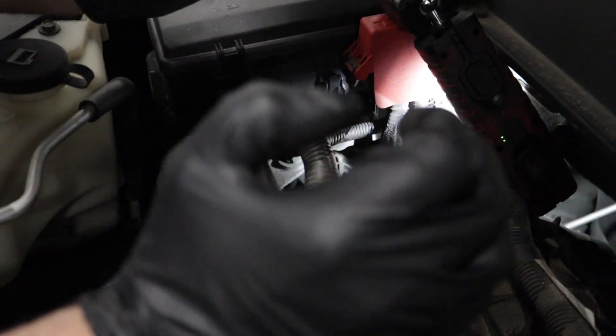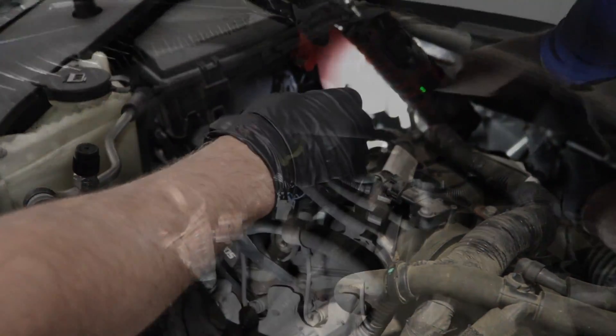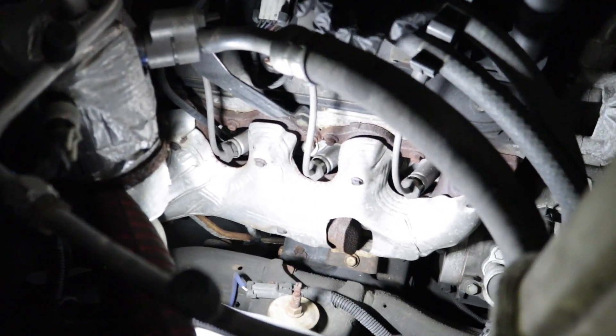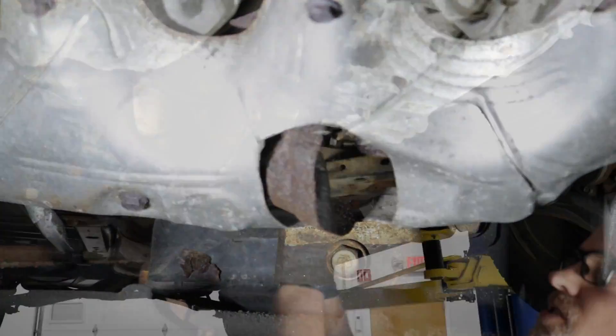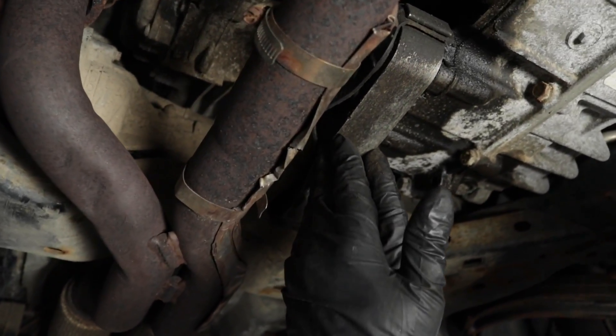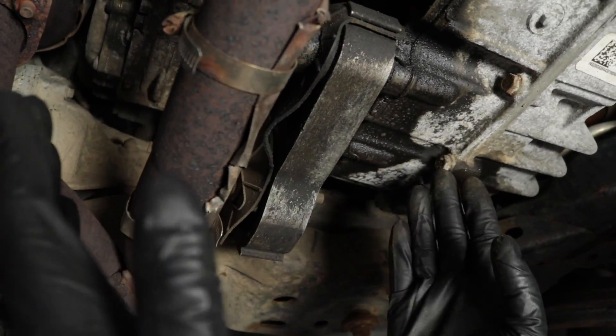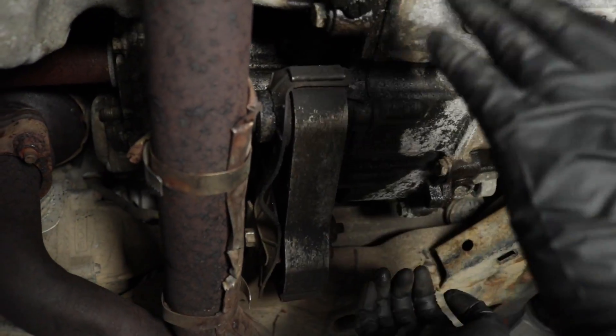This just prevents the engine from rocking back and forth. So if you saw a lot of movement in the engine rocking back and forth, that could be your problem. If you have a vehicle with a larger engine, there may be no supports up top and the mounts are just down below. Here's another dog bone transmission mount — it doesn't support any of the weight; it just prevents it from rocking back and forth.